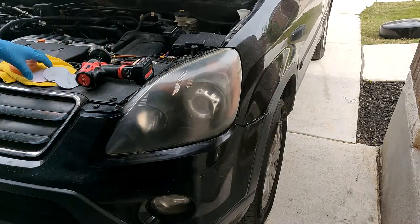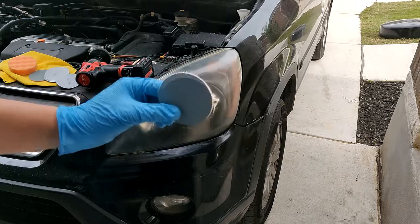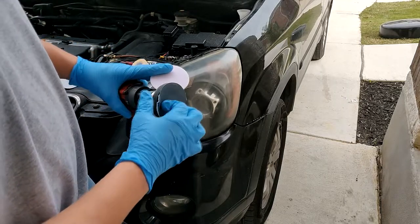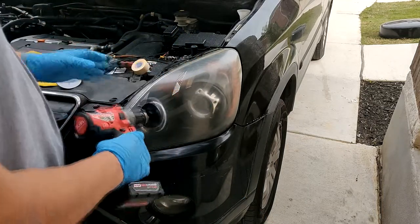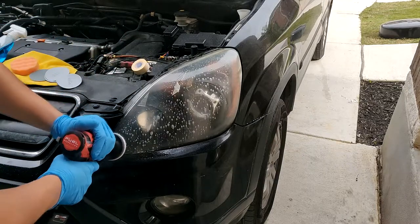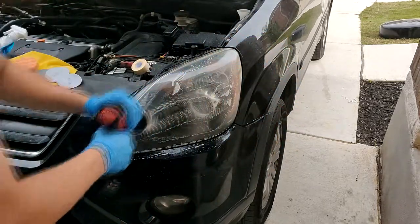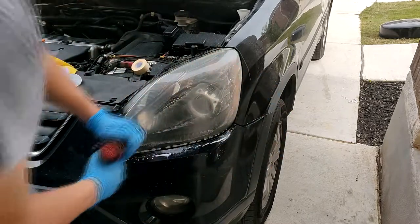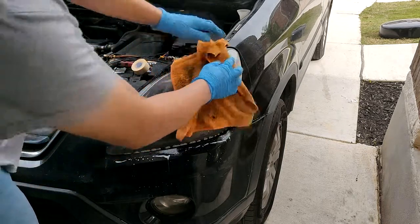All right, we'll be going to that. What was it? It doesn't actually say, but it's softer. I think it's like 1500 grit, or if not, maybe a 2000. Just going to change that out. And you can see it's only one time use. Add some lubrication, click back, and we're going to go the same way we did the first time. Down again.